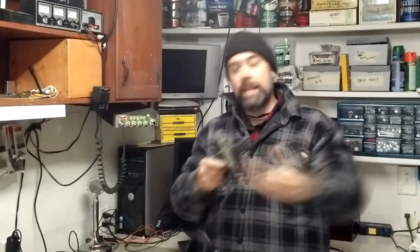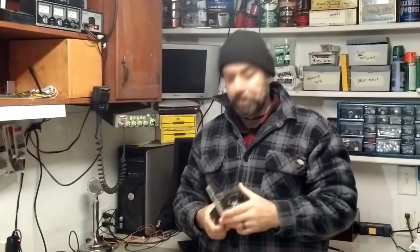And why does it do both? Well, it splits the signal so that this channel is isolated, and this goes to your car stereo. So your AM/FM antenna works as it would normally, and your car radio works as it would normally. The other end, the splitter and combiner, is taking the signals coming to and fro the CB, combining that with the antenna and sending it out the same AM/FM antenna that came with your car from the factory. It's great, it works.